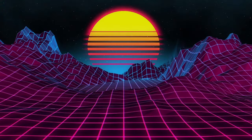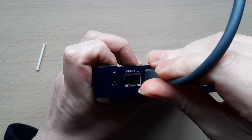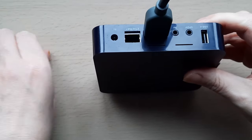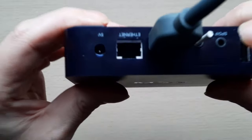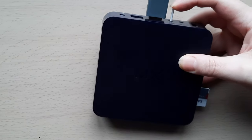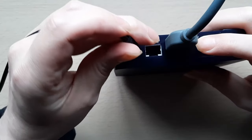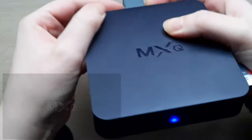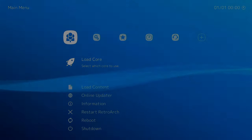We're going to move over to the TV box. Slot the SD card in there, plug in the HDMI cable, and drop the pokey prodder into the AV socket. The AV socket has a little micro-switch inside — you should hear a click when you put a little pressure on the pokey prodder. Now we need to hold the pokey prodder down, insert the power cable, and keep these pressed in until you see the LAKKA bootloader appear, then relax.